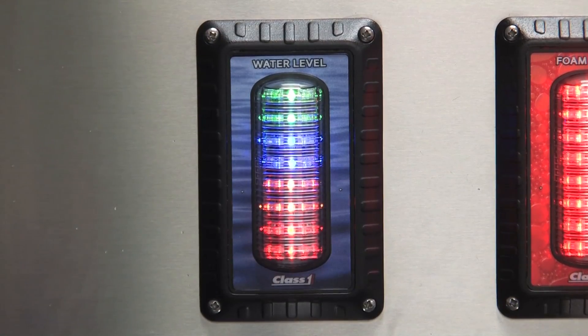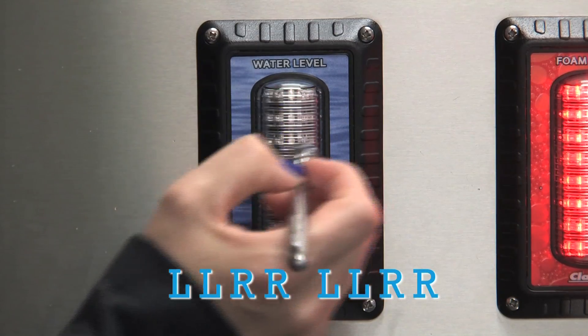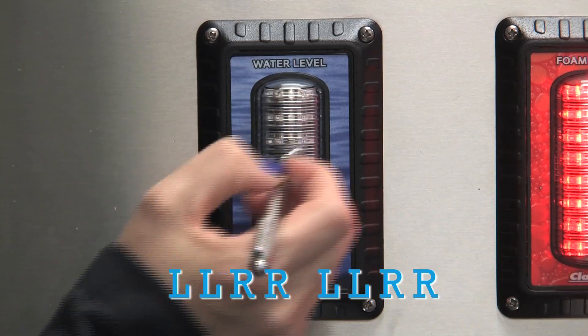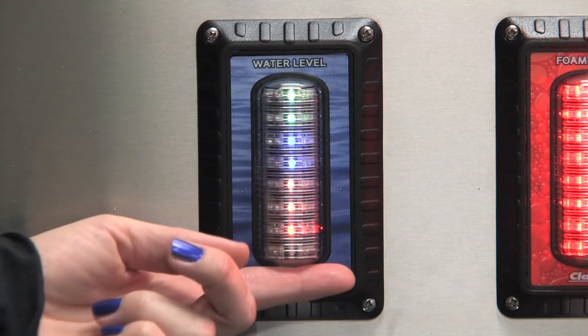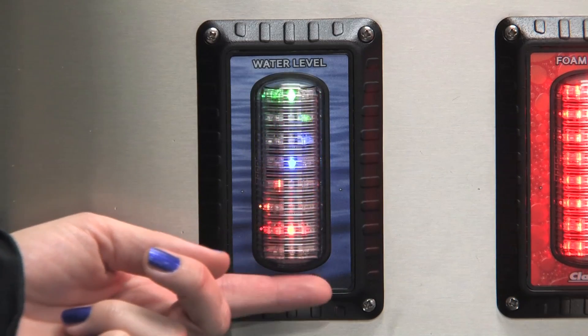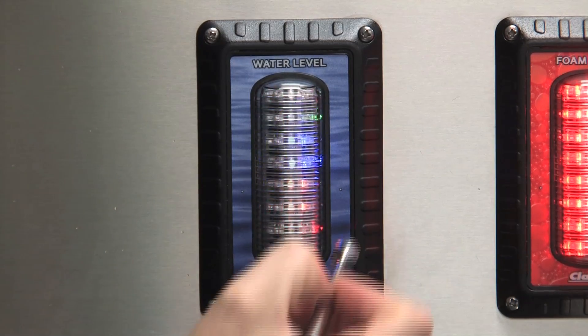To check your ITL 40's voltage, you're going to enter the sequence: left, left, right, right. It's now going to display volts and will give you a number — 4.26 in this case — and it's going to keep scrolling the number so you have time to write it down. If you want to get rid of it, just activate the right switch.